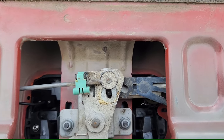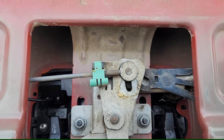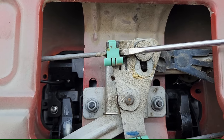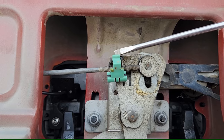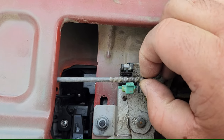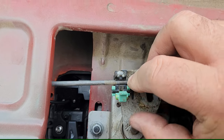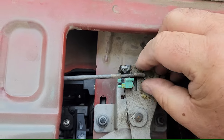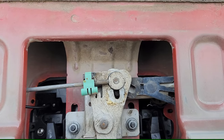If you're wondering how to adjust the handle after installation — you might find that when you lift the handle you have to lift it really high to make it engage. You can adjust these rods by simply popping open that plastic piece at that level, and the rod comes right out. Pull it until you feel tension, put it where you need it, and snap it back down. It might take a couple of tries to get it just right.